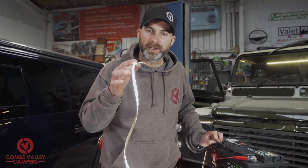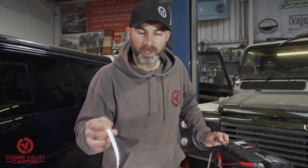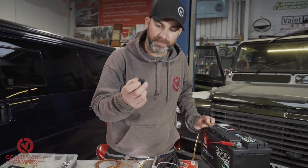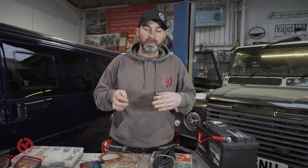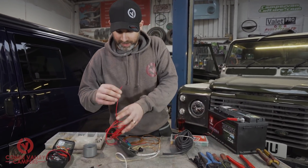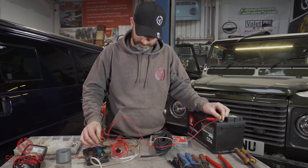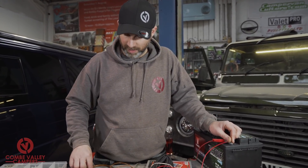Today we are going to make a circuit to turn on and off our LED lighting strip. We're going to use 0.75 mm² cable and a 10 amp fuse in a regular size fuse holder. We'll be putting a switch in the circuit — this switch has a little blue LED to tell you when it's on or off. We need a live feed from our battery to our lights, and a way to protect that wire from any overload, for which we'll use an inline fuse.